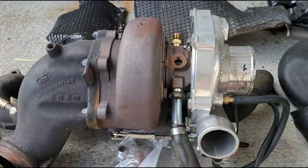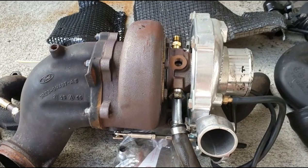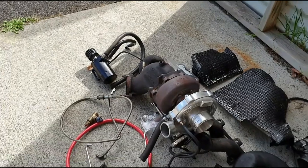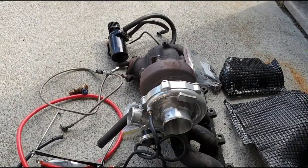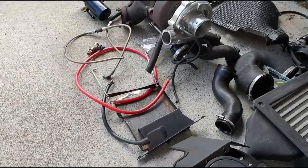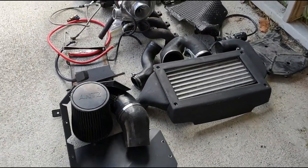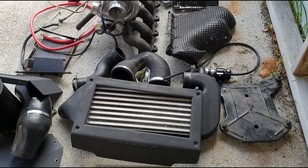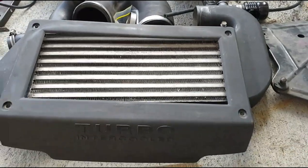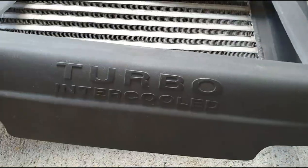We are going to chuck an oil catch can on there. I am not running water cooling on the turbo - that's debatable, but plenty in the NA community have run no water lines on low-boost setups for years with a lot of success. Moving on to the intake, we're running the Ants turbo-side intake kit, which means we'll also need to run the battery relocation kit. That will give us a good sound from the turbo and help a little with power. What's going to be different about this conversion is we're going top-mount intercooler.